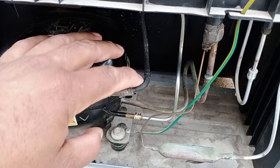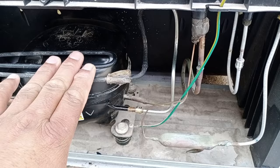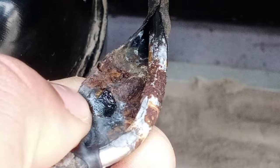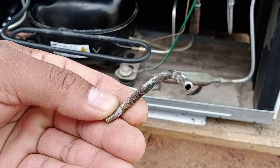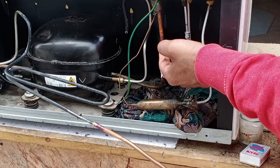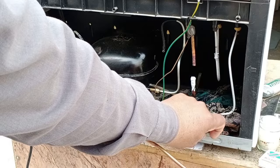Since nitrogen is a dry gas that absorbs moisture, the pressure we will pass inside the refrigerator pipes will be very low — 60 to 70 lbs per square inch. If we pass high pressure, the aluminum evaporator could get damaged. I have removed the heat shrink from the damaged area, and you can see the pipe is completely rusted with oil leaked from it. I am also opening the suction pipe to make the air out of this system. I have flushed the system and passed nitrogen inside the pipes for 20 minutes at low pressure to dry out any moisture.